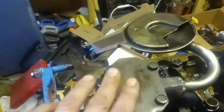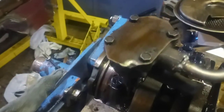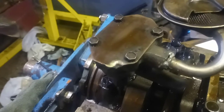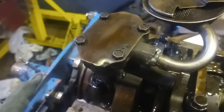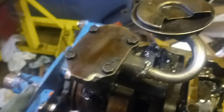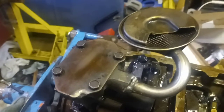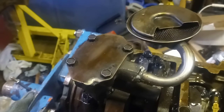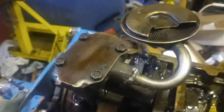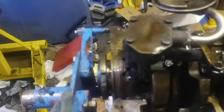If you're using a new pump, you should probably pop this off, fill it full of Vaseline, and put it back on. Under more examination I noticed damage in the pump and thought, what the hell happened there? It was a good motor, nothing came apart. Through a little detective work I remembered this motor was from Pick and Pull. Those workers can't use a wrench to save their lives, so they punch the oil pan with an air chisel — that's how they drain the oil pans — then jam a plug in. It's harder than pulling the drain plug, but that's what they do. I think when they punched the pan, they smoked the pump. But it worked good and it didn't leak, so we're just gonna run her the way she is.